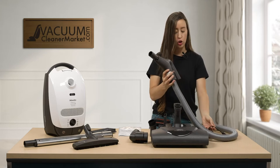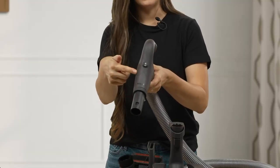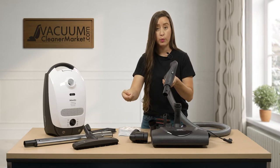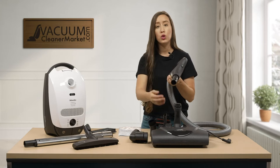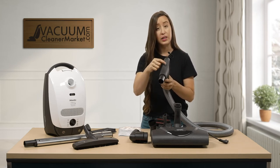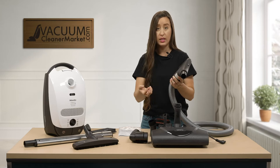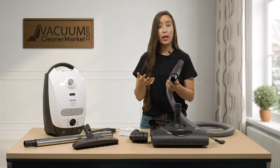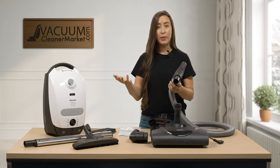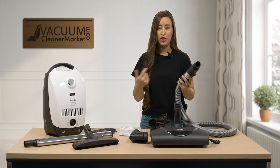This is your hose and your handle. On your handle, there is an X and an O. The X is going to turn your spinning brush roll on your carpeting power head on, meaning the bristles will be spinning. When it's on the O setting, it turns them off. So if you attach everything and your power head is not turning on, make sure you have it on the X setting. The O setting comes in handy if you have any rugs with tassels or delicate carpeting that you cannot clean with a spinning brush roll — it will just clean with pure suction. It's always recommended to clean carpeted surfaces with agitation for the deepest clean, but always check with your carpet manufacturer first.